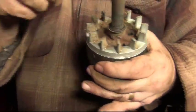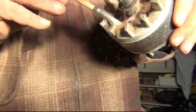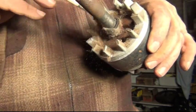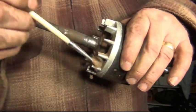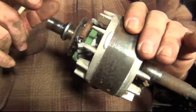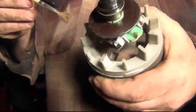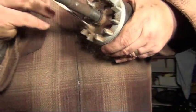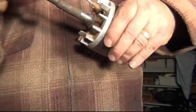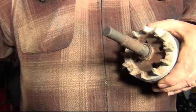There's some water that got in there too. Right now I'm cleaning this — I just take a little brush and go through it. A lot of dog hair as you can see. I'm going through all the blades and the fan. There's a whole bunch of stuff in there. On the other side, make sure you don't disturb the clutch — just clean around it as much as you can. Then you can blow it off with an air compressor.